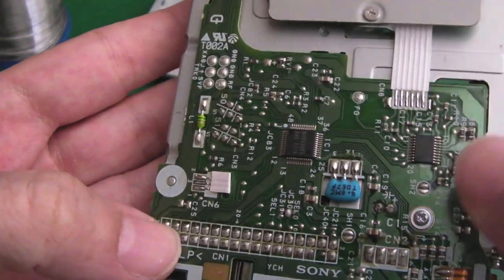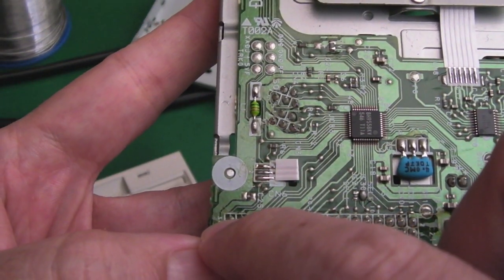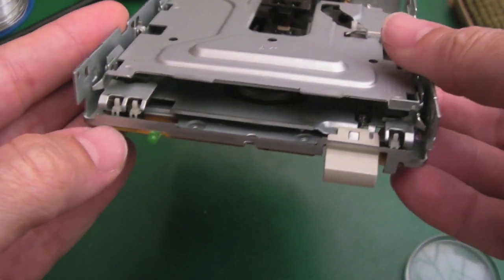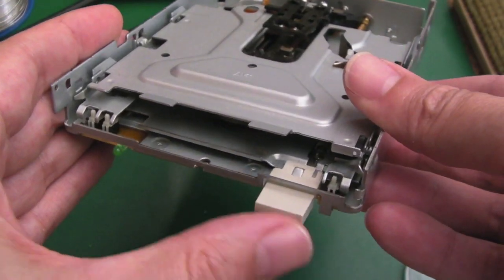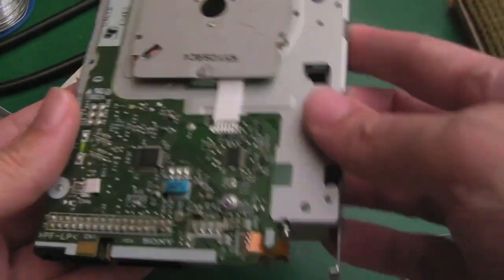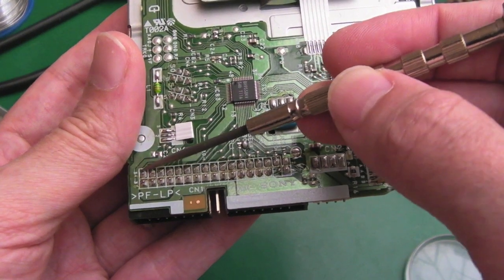So I just need to work out where the switch is connected to, and I think cut whatever's going to 34 and join a wire from there to wherever. So a correction, actually, these do have a disc change switch. You can see we've got 2 here. So that's actually a correction to the recent Amiga 2000 video I did. I don't know why, I was assuming that was the thing that needed change, but it isn't. My memory's getting mixed up. It is the disc change pin, so 34 here. We need to break the trace that goes to that.